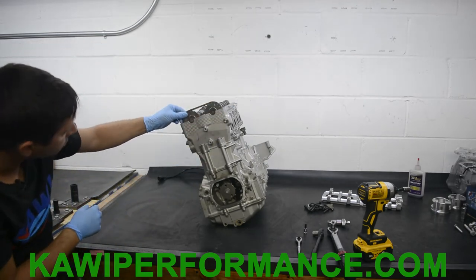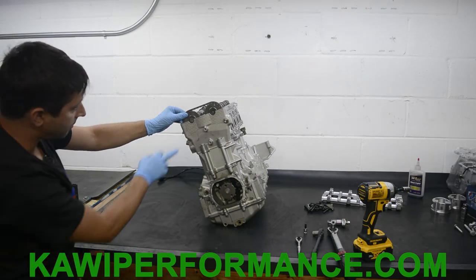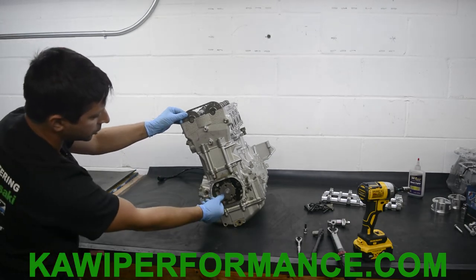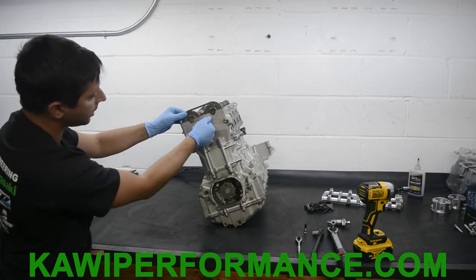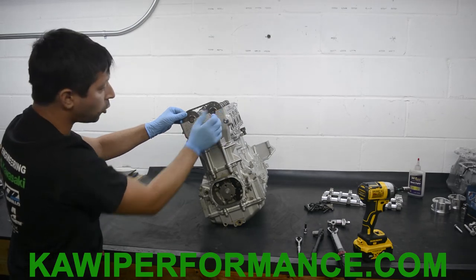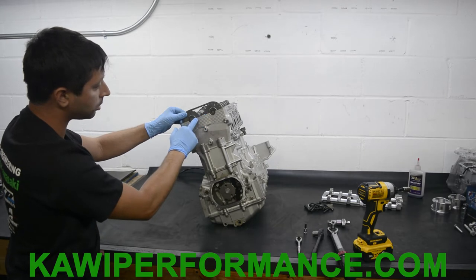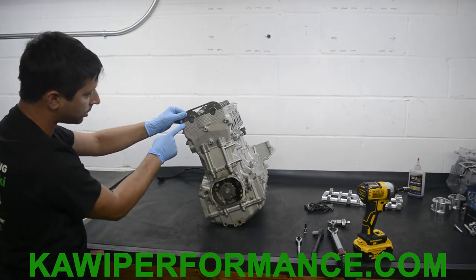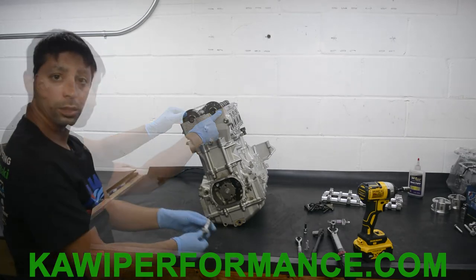So I'd say that looks pretty perfect here. So we have our single notch here with the case half. We have our in, our single dot, and we have our exhaust, our double dot over here. So don't make the mistake where you're looking on this side and lining things up. It's always a single dot or an in here, or a double dot or an exhaust here.